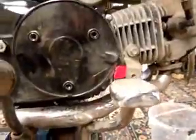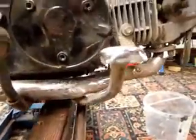So that means I've got to take all these bolts out round here, which are all 8mm by the looks of it. And the kickstart will come off. I'm hoping I won't have to take the exhaust off, but I might have to take the footrest off — we'll see.